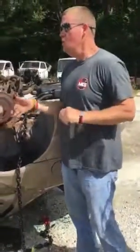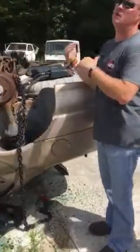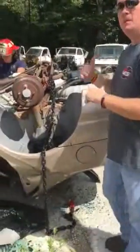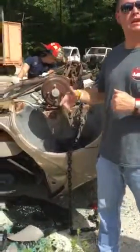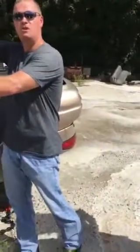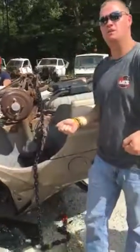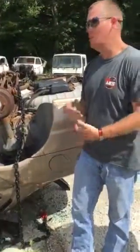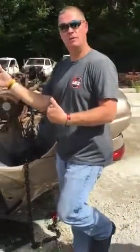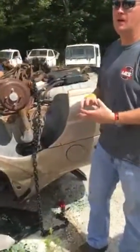So what if we were able to strut this vehicle, take a little bit of pressure off of those posts, then go around and cut every single post, then lift the vehicle up and leave roof, patient, and all on the ground? Then we can just slide roof, patient, and all out, using the roof line as a backboard for us. There's a whole lot of things that lifting struts will give you in this capability.